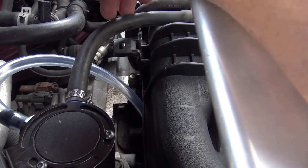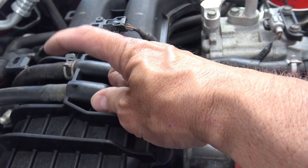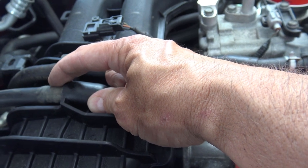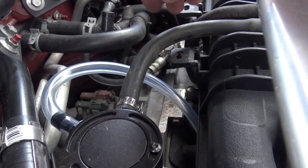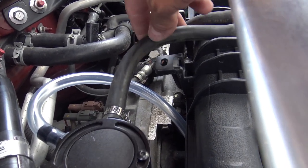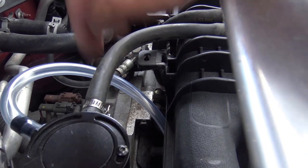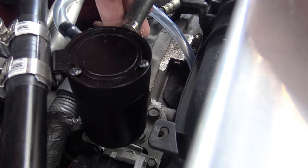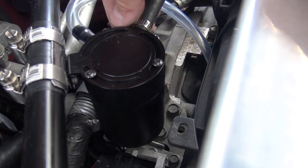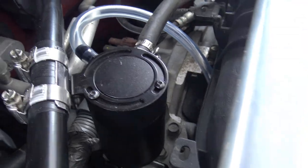My 3/8 clear tube worked fine for the intake. For the outtake, I found some spare hose that was flexible enough to fit both connections. If you get the really heavy-duty fuel hoses, they're just too heavily constructed — too stiff to actually fit a large and a small connection. So you've got to find the right rubber hose. For this type of crankcase ventilation you don't need a super heavy-duty hose; something a little lighter, a little more flexible, a little more stretchy might work. I've got this held on here with a hose clamp. The bracket's a little bit light duty — I should have made it in heavier metal so it won't vibrate around. And of course I do want to paint these so they don't show up too much. So definitely a little ghetto.